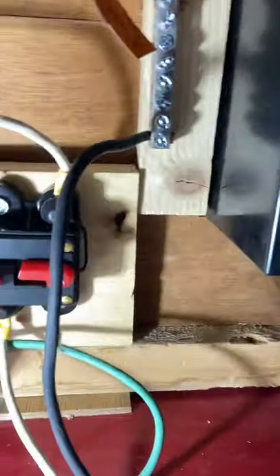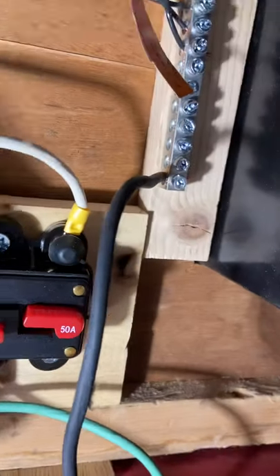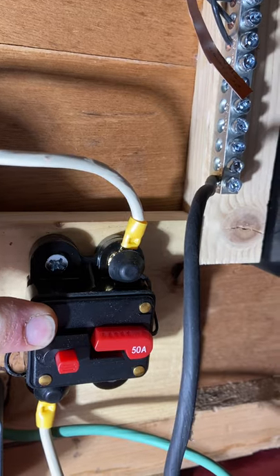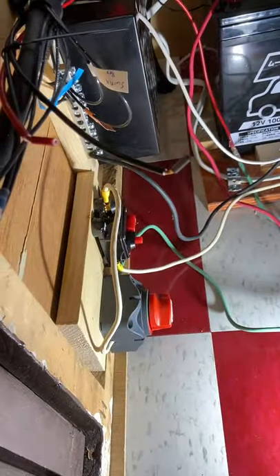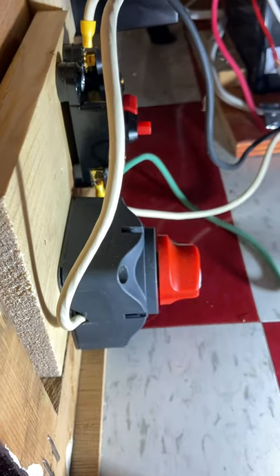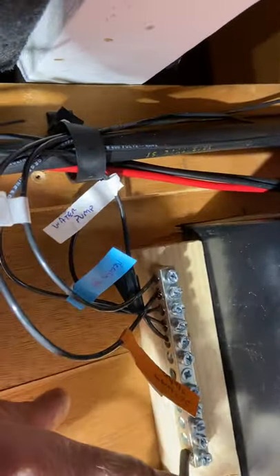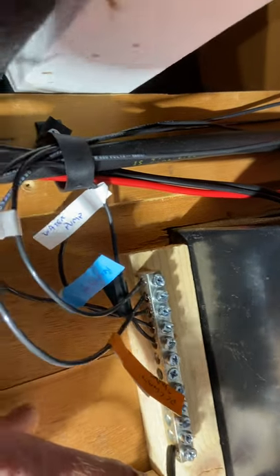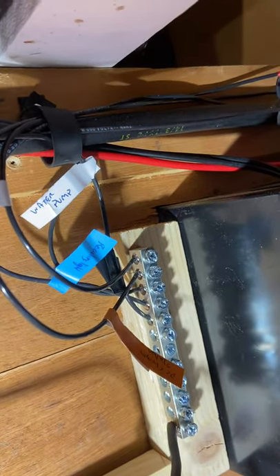For the battery, I put in a main off switch and a 50 amp circuit breaker. Those are connected, and I have this under the bed — I can reach in and turn the battery off if I need to or access the switch. Obviously I just need to lift the bed up to get to that. I also put in a bus bar for the DC negative, so everything coming back goes to this bus bar, and I still need to ground this to the frame. I just need a little more 10 gauge wire — I ran out and I'm waiting for it to come in.